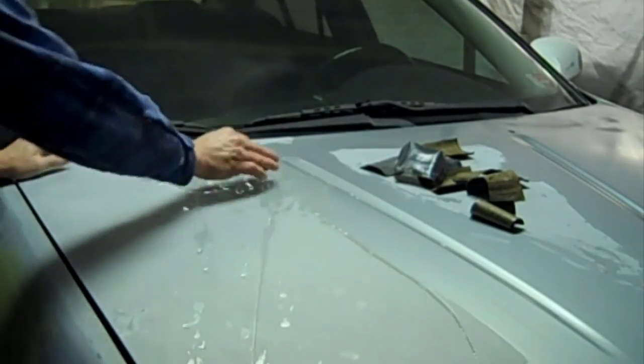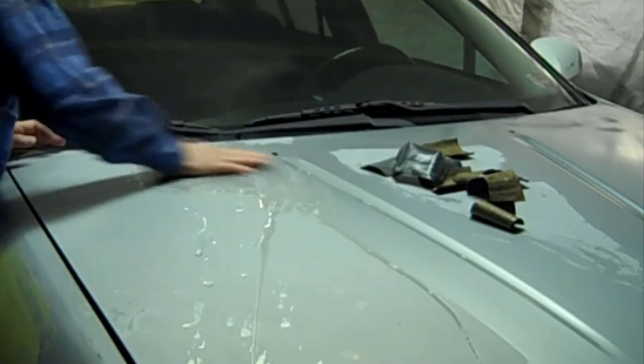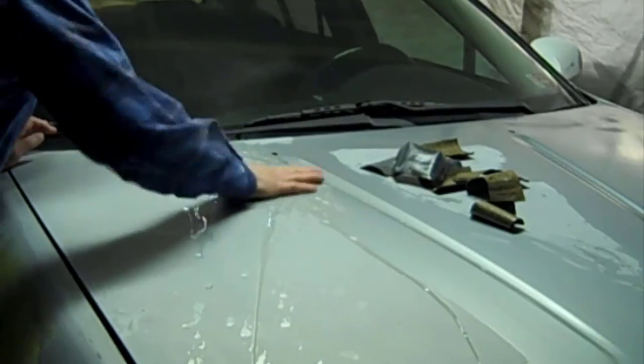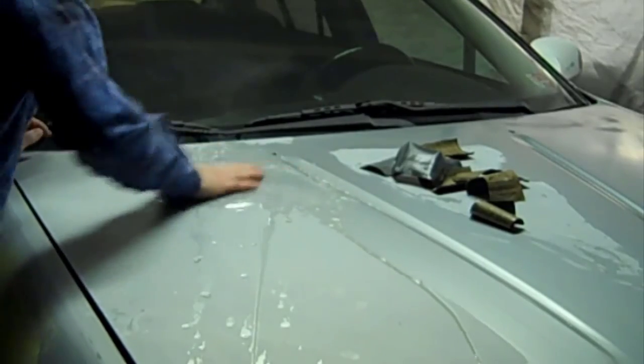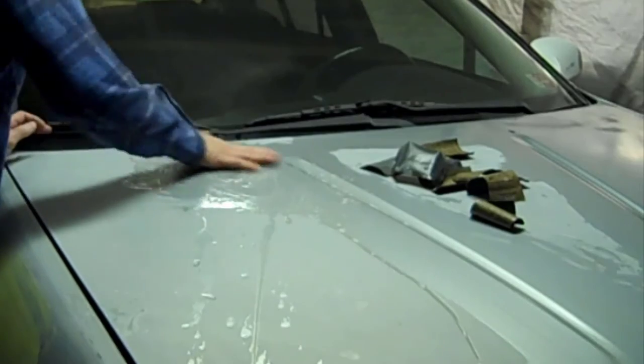After DA, or using a dual action sander, you can use a pneumatic or an electric, either one. And I'll put those down in the description for the type of tools I've used. After using that all over the front clip that I put on, and working the body filler stuff, then I'll go and wet sand.